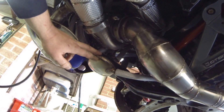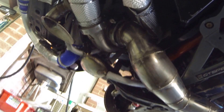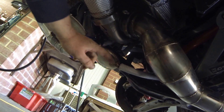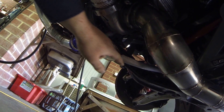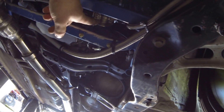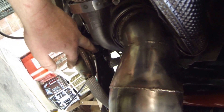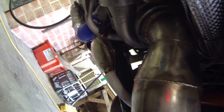Because the turbo is low mounted and actually below the sump level, to get the oil to drain back into the engine, first it drains into this sump that I've built here, coming straight out the drain. From there, at the lowest point, there's a pipe that siphons and goes around to here. There's an oil pump, a MoCal oil pump, that pumps it back around into the sump up there. There's also vents from the top so it doesn't pull vacuum. It's untested at this stage, but hopefully it will work and not cause any issues.